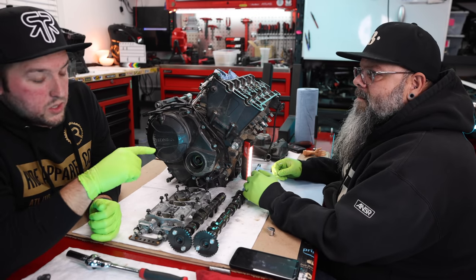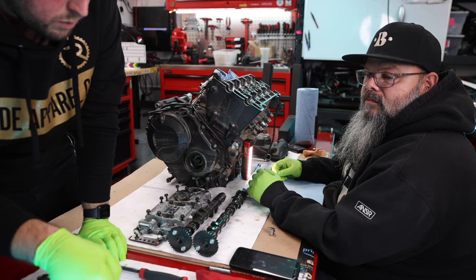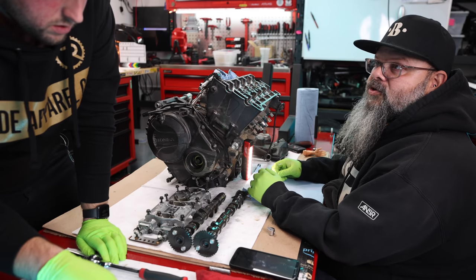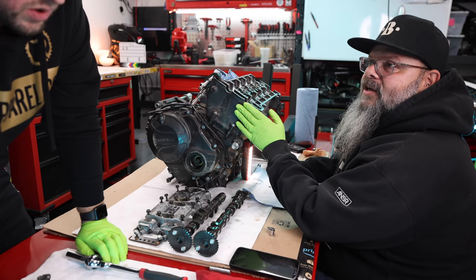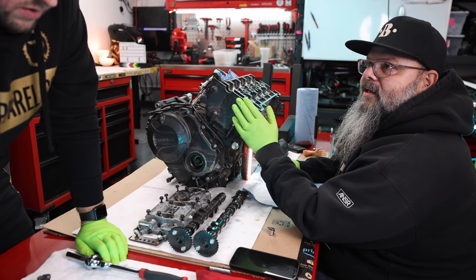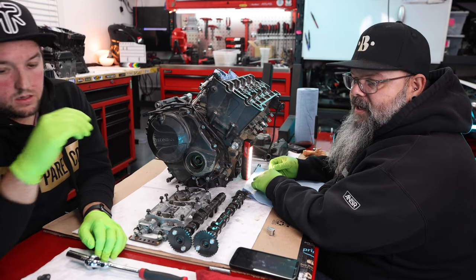You pulled out a 2 what? A 202. So are we able to put the 202 in the 202 bucket area? Well, there isn't a 202 bucket. There is a 200 and a 205. There is no 202. So this is what I was saying, that the manufacturer shims go by every number, and then when you buy a shim kit, they go by every fifth. But you did say we can keep shims. Yes, we can keep them, but we don't want to put it in the same spot.